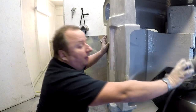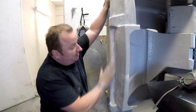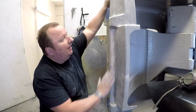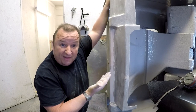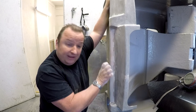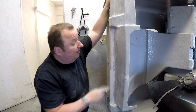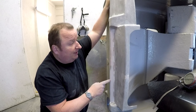That's it. That's probably the last bit I'm going to do while the car's on its side. As I say, it didn't really take too long to sand down. There's a little bit of stopper filler in there, and one final sand down, and that's now ready. It's surprising how much filler you actually do get off with some 80-grit paper - you really shouldn't need to go any further with that. And don't forget, this isn't deep filler here. All we've got basically is a thin skimmer filler. The main bulk of the actual repair, as you probably know, is fiberglass. This is just to smooth out any sort of bumps or little divots that you've got - that's why we use a polyester filler.